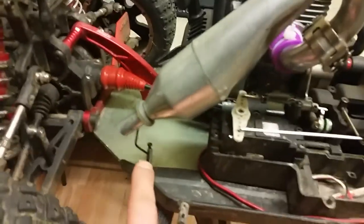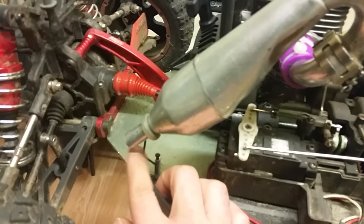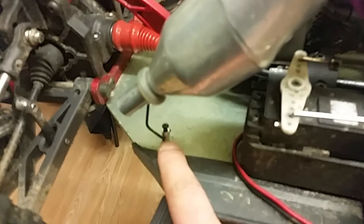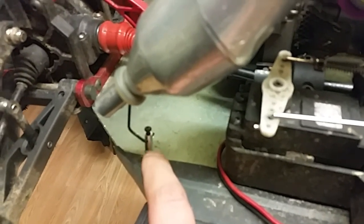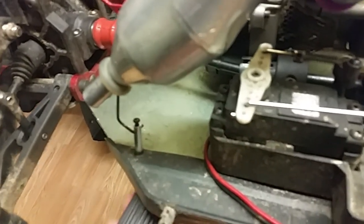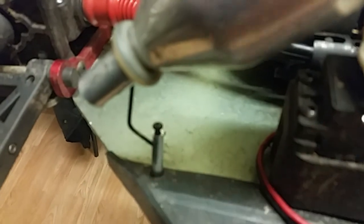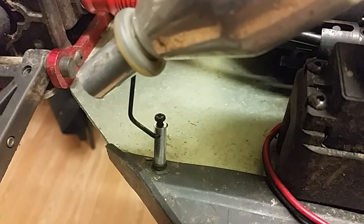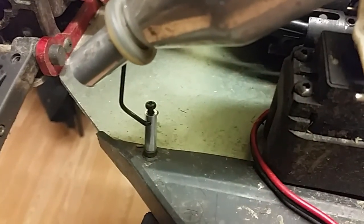It comes down and is held by the original mounting bracket down to the chassis. Over here I've used a 20mm servo mount — I got that from Blacksmith Products, they've got tons of those. Unfortunately I couldn't find my M4s so I ended up using an M3. So instead of an M4 coming from the bottom, there's an M3, but it's holding everything in place as it should. I drilled the hole so I could put the mounting bracket through, then put an M3 through the top to hold it in place and thread-locked it. That holds it in place.